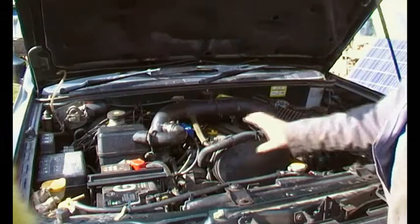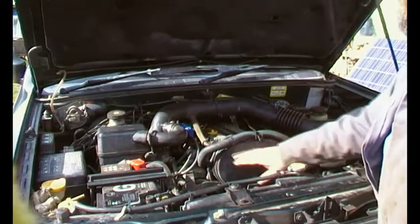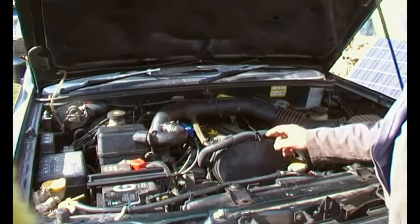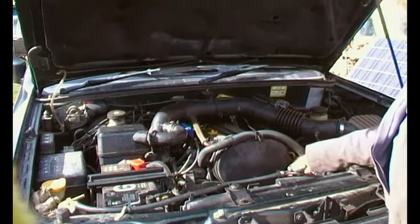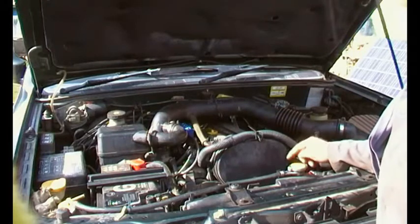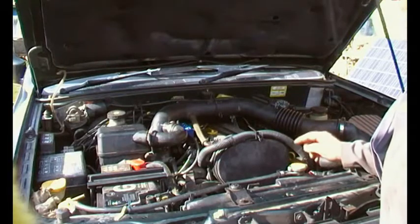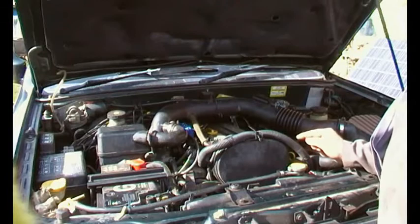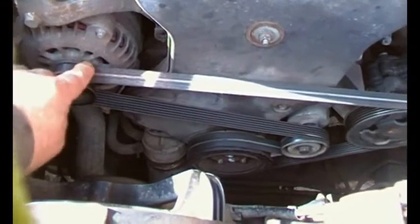There was a big plastic lump here so I've removed that because all the little clips were breaking. The original wiring loom is now just clipped on there. We're going to remove various things — we've got to remove the ancillaries belt, and I'm going to show you this because if you take this belt off and don't take really full notice of the way it's set up, you can try to put it back and find it's too long.